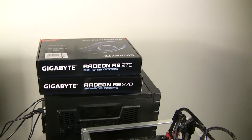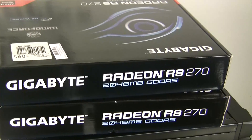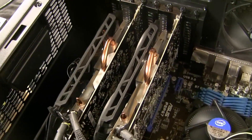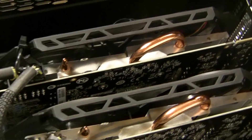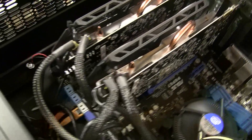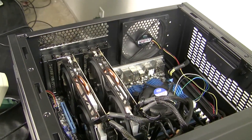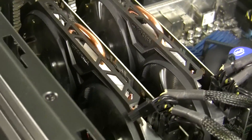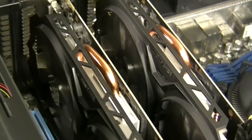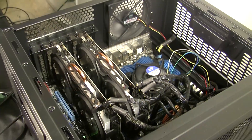The next card in this shootout is the R9 270 — some of my favorite cards from Gigabyte, and I say that because the cost is right on the money: $179 right now at Micro Center. Couple that with a very consistent 430 to 450 kilohash rate with very limited power usage and you've got yourself a winner. In a later episode we're actually going to take six of these and put them in that new BTC board from ASRock — cannot wait for that board to show up.